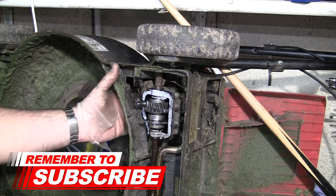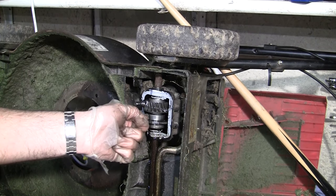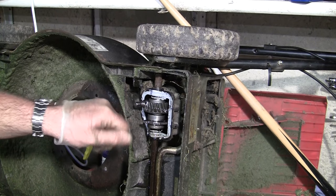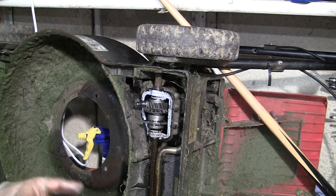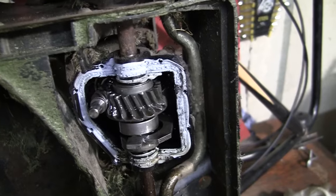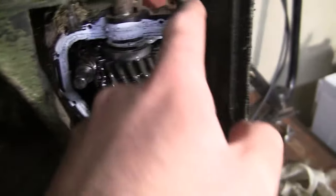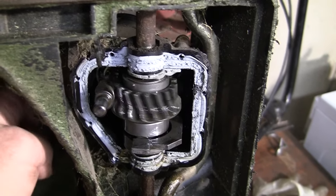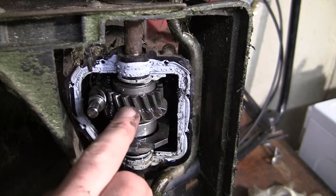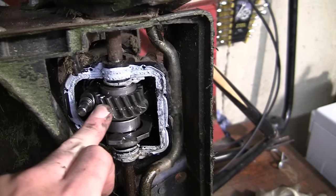That's really what you need to check — it's not ideal taking all that off, but I wanted to show you inside. You can see the worm gear and the other gear it sits against. This part here needs to move across. On a lot of the cheaper ones, you have a plastic worm gear or a plastic part here. Over time I see these are so worn out they've got teeth missing or they're so flat that the worm gear doesn't connect, so the drive doesn't engage. This is a 15-year-old lawnmower and that part still looks like aluminium — it hasn't worn away at all.